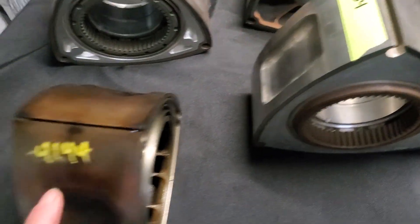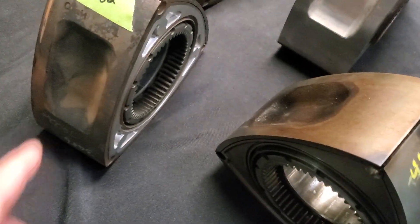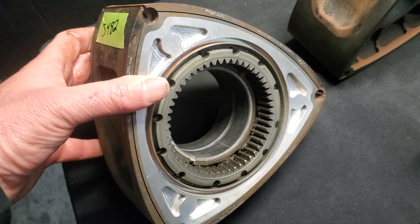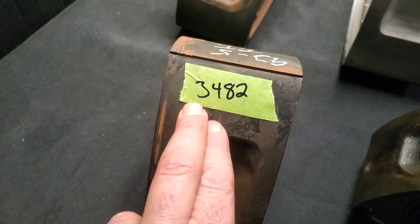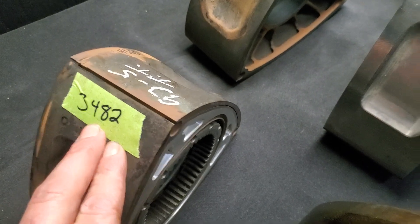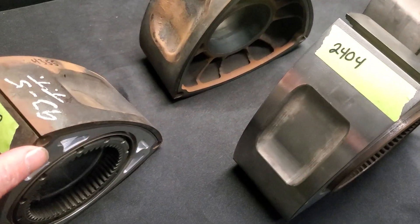In an effort to take that much further, you can see we were getting into the low 40s, probably low 4,200s with that cutting. With the aluminum face rotor — by just removing the faces and inserting aluminum — we were able to drop that down to approximately 3,482 grams, depending on the rotor you're starting with and how you do it. So we shaved about a quarter of the weight out of that rotor, which is pretty significant, just by aluminum facing it.